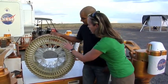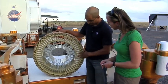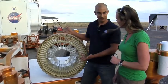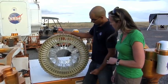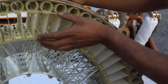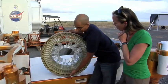Can you talk me through it? It's like metal and plastic and all kinds of cool stuff. We work with some of the major tire manufacturers. This happens to be a lunar tire we developed in partnership with Michelin. They call it the tweel — tire and wheel. It deforms like a tire, but requires no air or rubber. If you put weight on this tire, the outer band grows and these spokes go into tension. The amount that they stretch is the amount that this wheel will deform at the bottom, so it deforms like a tire.